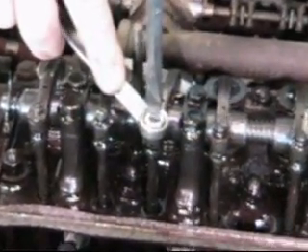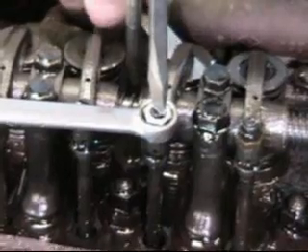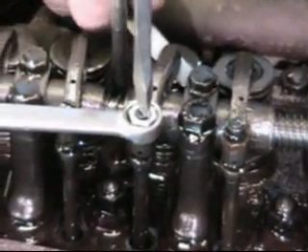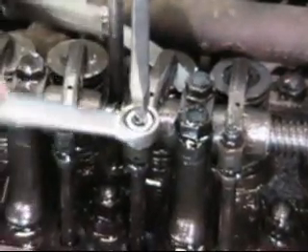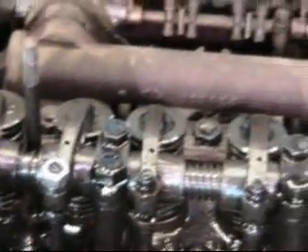We take this guy, who is missing his adjuster nut, which must have fallen down inside the sump. So I added an 8 by 1 metric nut, because remember the inside of the engine is always metric. I got a drag on that and this guy's snug. So two valves are adjusted.